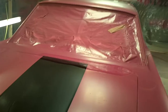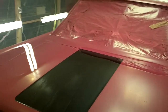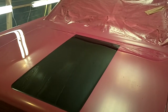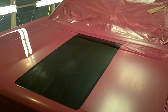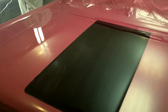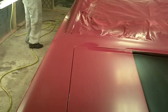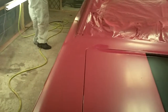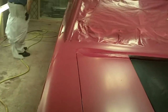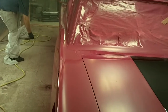The hood scoop's been painted black and we've clear coated the hood scoop. I ran out of clear coat right in the middle of spraying the scoop and it left a real dry orange peel on it. I spent yesterday wet sanding it, and I actually wet sanded through and got down into the sealer in one or two spots right there on the hard edges of it. So it's going to take a little bit of touch up with the black paint, or I can re-clear it.